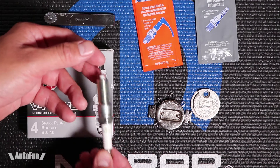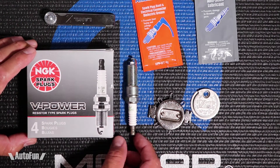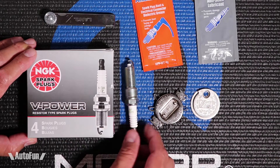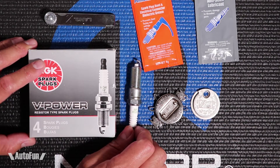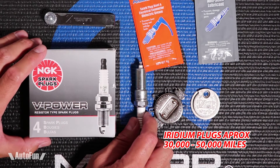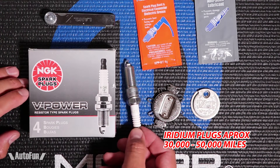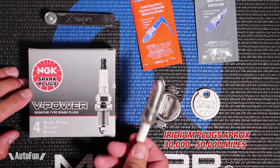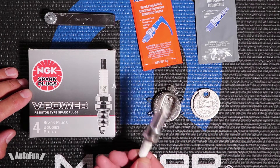It is very cheap to constantly have brand new spark plugs in the car, and that allows me to look at the spark plug every time to see if there's anything going on with it. It also allows me to remove it and ensure that it hasn't seized up. There are other types of spark plugs with more exotic materials such as iridium, and iridium spark plugs are potentially rated all the way up to 30,000 to 50,000 miles between intervals.